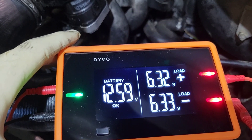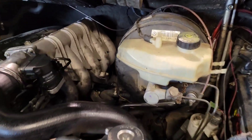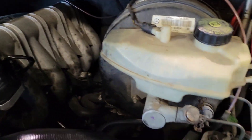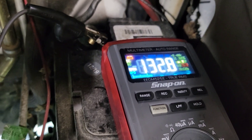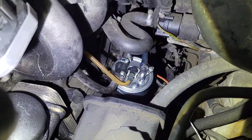I know for sure that this thing needs an ECM and not a wiring repair. For confirmation, I cut the signal wire right there and I don't have any voltage — that shows I do not have a short in the harness, because if I did I would be reading voltage right now. With the ECM plugged in and the water and fuel sensor plugged in, I have system voltage indicating that I have a short in my ECM.